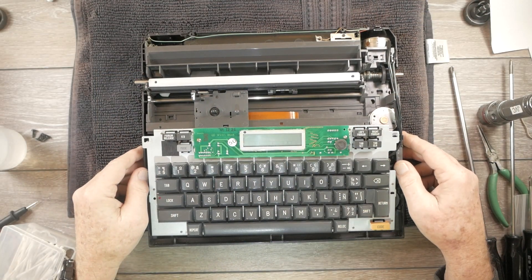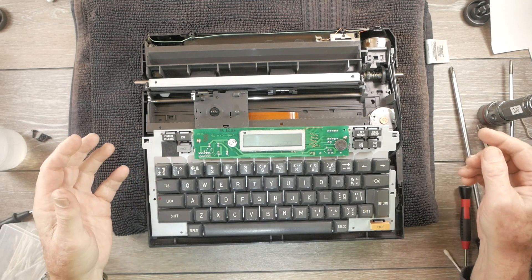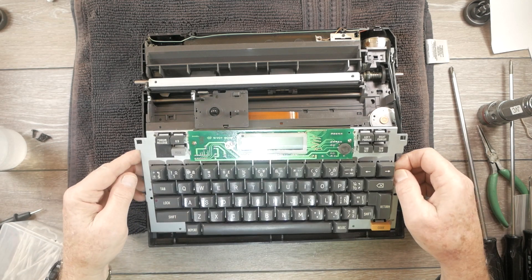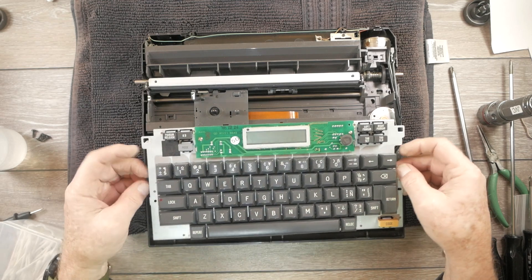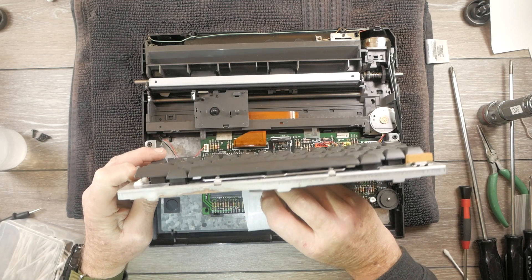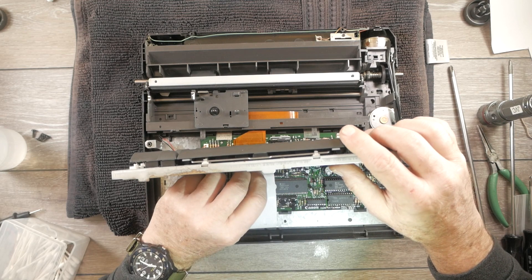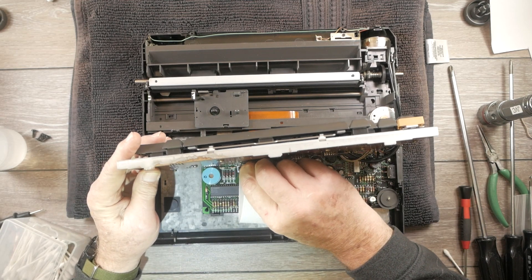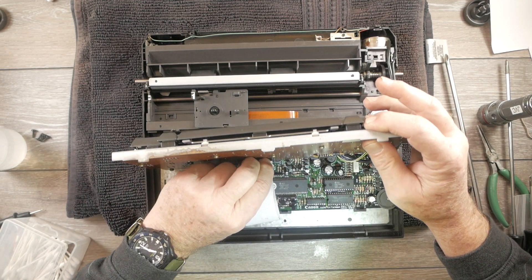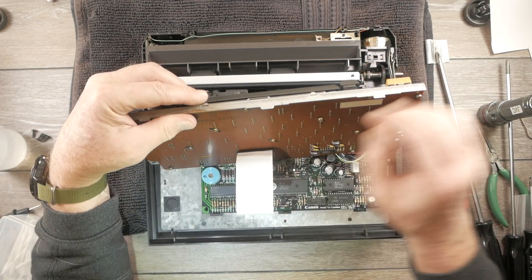Now I'll start from one end to the other and tighten all these screws really well. If you haven't serviced your machine before, you'll probably find it's really dirty inside. I want to make sure and test the work I did first before going any further. This is the way the keyboard sits in the machine — flip it over and the cable has to fit into that connector. Be very delicate — this is probably the most delicate thing you'll do to this machine. Get the cable lined up and push it down so all the metal parts of the ribbon cable seat themselves properly.